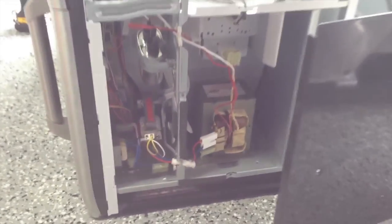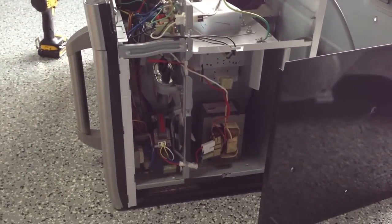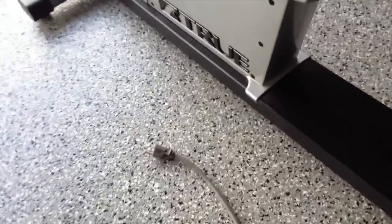This is the right side of the microwave if you're looking at it from the front. It's these two connectors at the very bottom — this one and then the one right behind it. Disconnect them completely, let them sit there for a minute, be safe, reconnect them, and then go ahead and put your access panel back on.